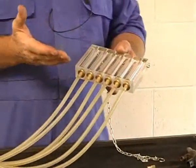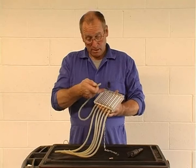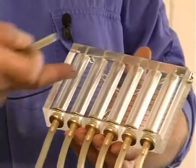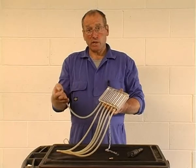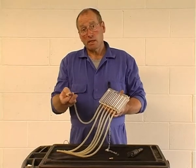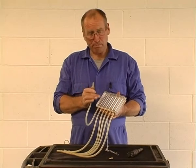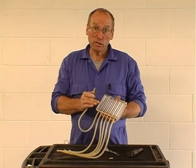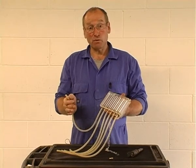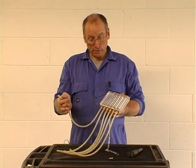It's a very simple test whereby we collect the amount of fuel discharged from the injector into these beakers and evaluate them whilst the engine runs through a number of performance conditions — either at idle or full throttle. It's important that we test the back leakage performance across the entire pressure range. Most Common Rail diesels perform between around 300 bar at idle to around 1,600 bar on full load.